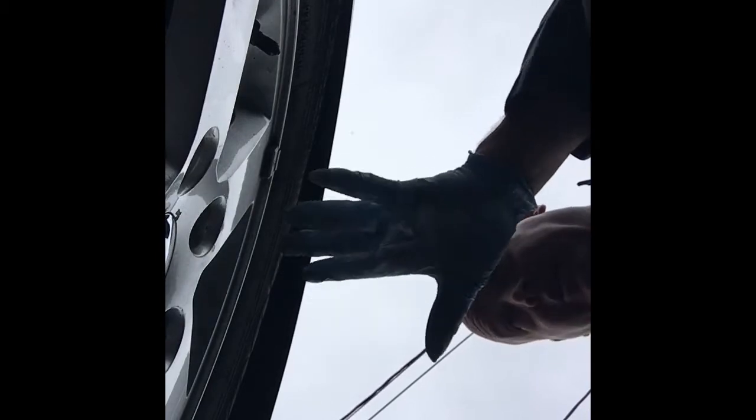Hey, it's me, Russ. Another safety tip: now that both sides have been tweaked, you've changed the brakes on both sides. One thing you need to keep double checking, safety wise, is two things, like a peace sign. The bolts on your brake caliper are tight, like I showed you in the video. It's very important that is done on both sides of the vehicle, because you don't want your brake caliper coming loose. That could be horrible, catastrophic stuff. So number one, both brake calipers have been tightened down.